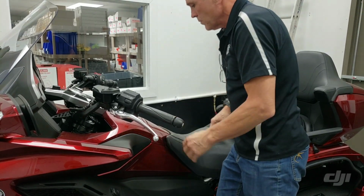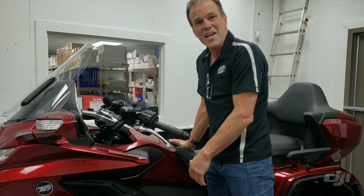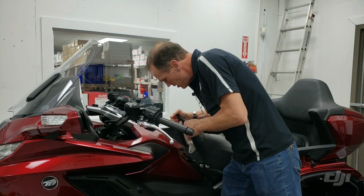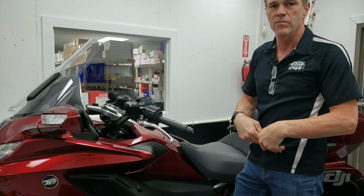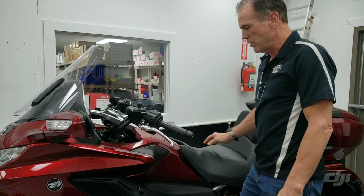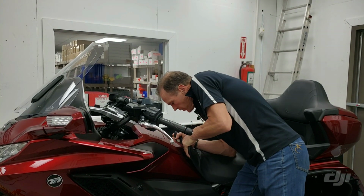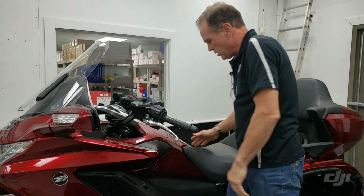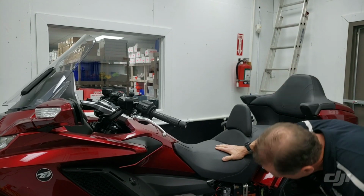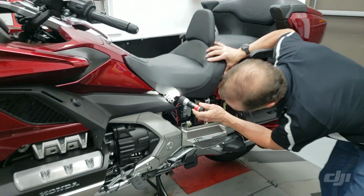You see that? Now, what's happened is people just skip that step. They don't know. Then their seat won't go, and they just push down on it, right? And we've come across people who just bent that whole tab against their seat pan and never knew it. Then they force the seat down and fight to get the hardware in. Now, even properly installed with the tab, when you flex the saddle back and get those to drop, the bolt holes won't line up properly. The seat will always be forward slightly. Come look. The bolt hole in there won't line up.